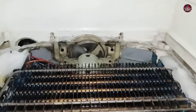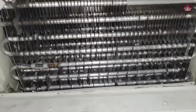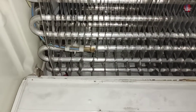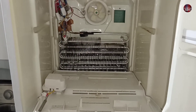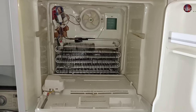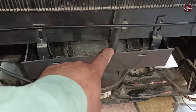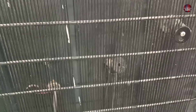These no frost refrigerators defrost the ice on the evaporator after every 6 to 8 hours. It has a drain system installed in it. A hole would be present here. The hole is connected to the drip tray installed on the compressor, and the water which drains goes inside that tray. This is the drip tray that collects the drain water. This is the pipe coming from the refrigerator's freezer compartment, and the water will flow inside the drip tray from the freezer.